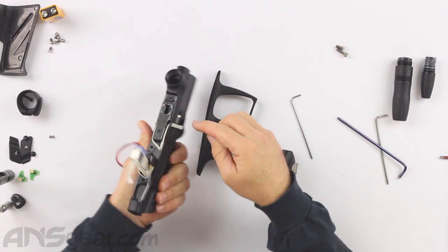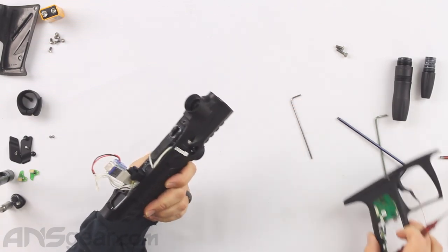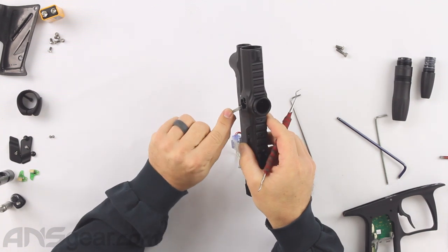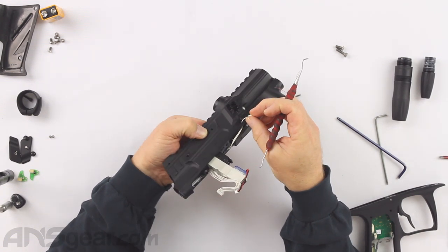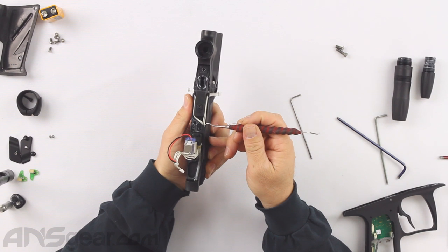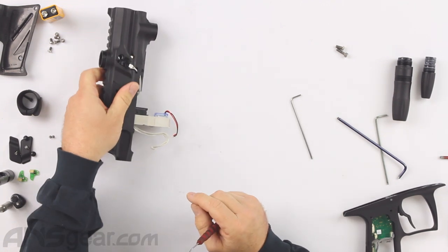You can see that our eye wires come from both sides and go underneath this part of the manifold right here. From a top-down perspective, the left side has the four eye wire side, the right has the two wire side. They come around the front of the body, come together, then run underneath the manifold and up the back side where they connect to the board. So we're going to open the rest of that up in a minute.